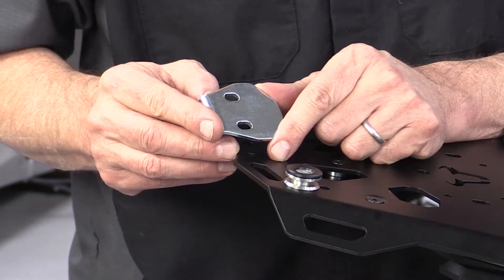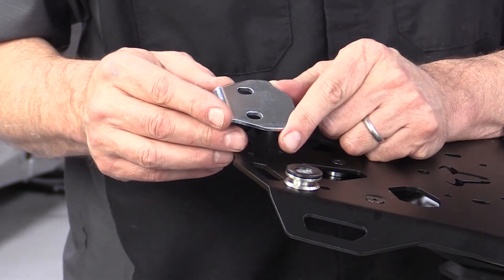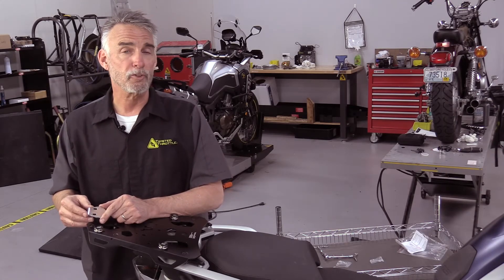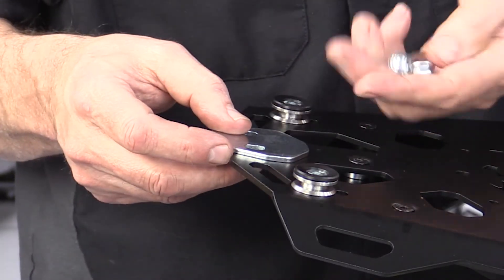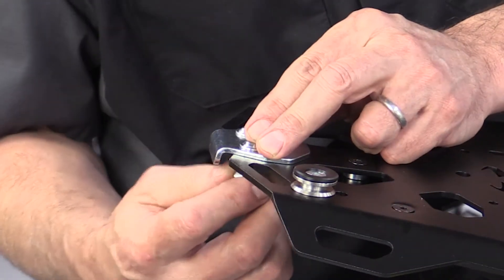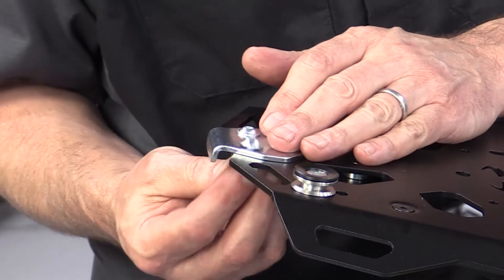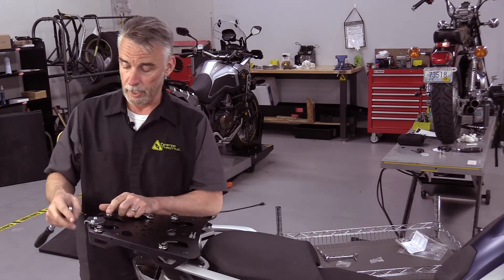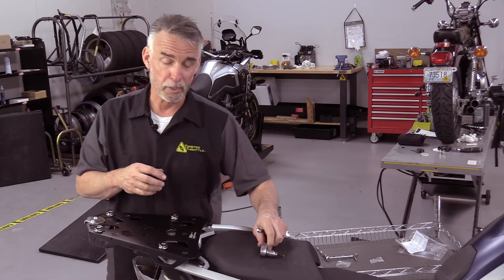The last piece of the puzzle is to install the latch mechanism — just drop this on top. There are two screws that go through. One recommendation is to put it on loose at this point because there's a little bit of fore-and-aft adjustment, and we'll double check that when we actually put the case on. This does not require Loctite because we have locking nuts. Get it snug so it's about halfway, and we'll refine that as we put the actual top box on. There's a little bit of variation. Get it just loose enough that we can move it around to check the fit, but not so loose that it goes all over the place on its own.